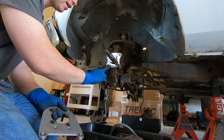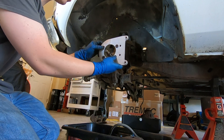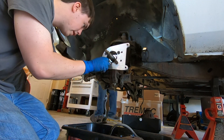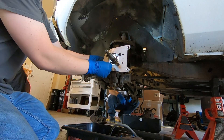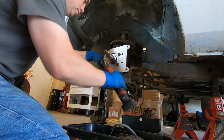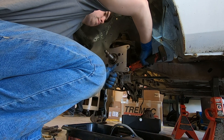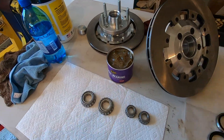After cleaning off this spindle, I've got the bracket — put all the bolts through and put the bracket on just like this. They have some countersunk bolts here and I've got some locking nuts that go right on the back, and we'll tighten this down. Our next step before we can put these new hub assemblies on is to pack the wheel bearings with wheel bearing grease.